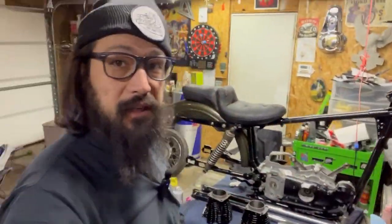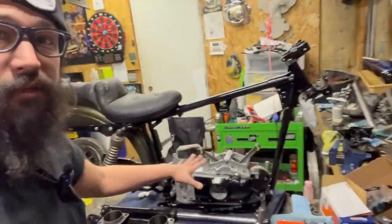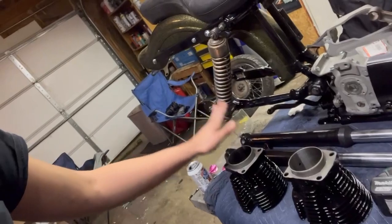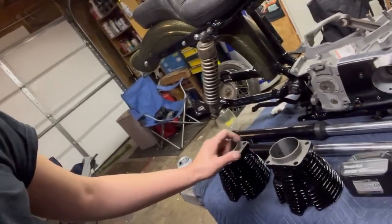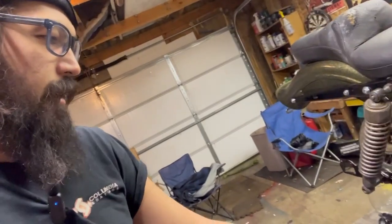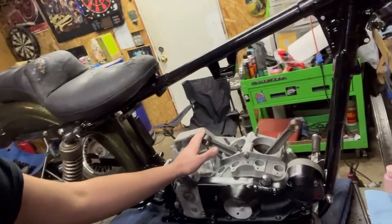What is up, YouTube? Back in the garage again. I've been kind of on hiatus. I got the cam chest locked down, got the forks rebuilt, just washed up the cylinders in the parts washer because they still had a bunch of machining oil in them. Cleaned all those up. I'm going to file the edges of the base, just knock down that high powder lip, and then we're going to throw the pistons in and get the cylinders on today.